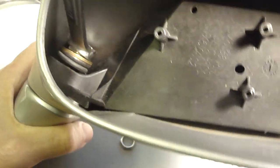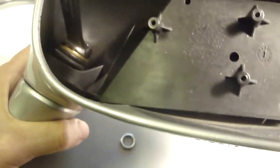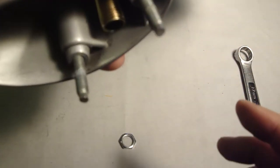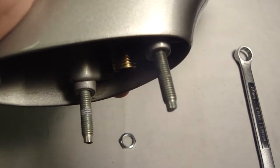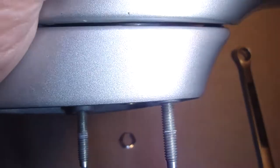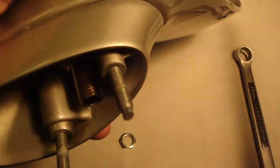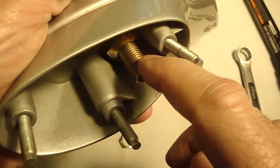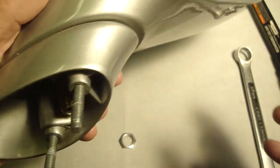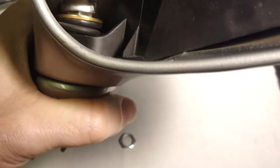I'm putting that second top nut off. Oh, one other thing. If you look at the clearance on the bottom, this is the 3 inch lamp nipple. It's too close for comfort to the profile of the pedestal bottom, so I want to trim off maybe a quarter of an inch or 3/8 on that part of the nipple. I don't want it scratching the paint of the door.